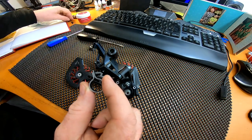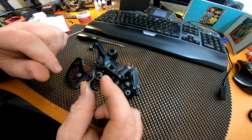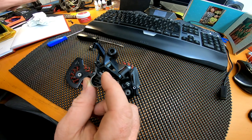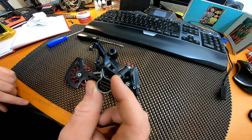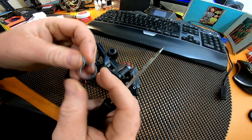Another thing I've noticed: these spring arms are two different lengths. The longer side goes on the cam tensioner side, and the shorter side goes up against the little screw — that's the correct orientation. If you put it in the other way around, as you go to fold the cam on it won't sit properly and it'll pop off. On the M7000 both arms are the same length so it doesn't matter, but with the M7100 it has to go in the correct way.